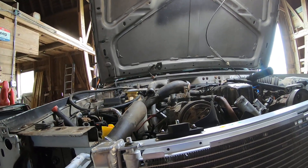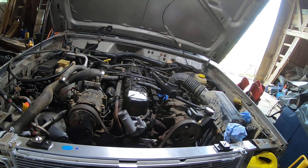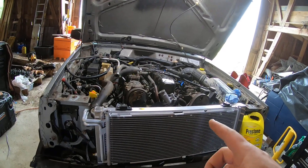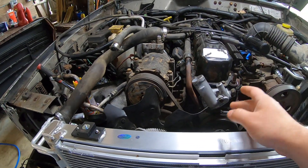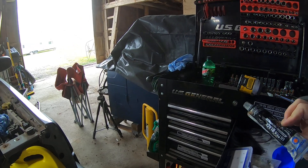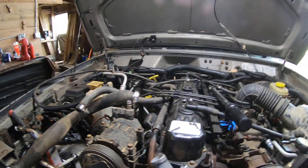If it's running good and not overheating, I'll probably drive it a couple hundred miles and do another oil change just to clean the system out and get some fresh oil in it. That's where we're at with Project Bravo. I keep running into the issue with seating this thermostat. I put the ultra black on a little thicker this time.